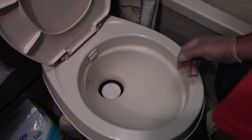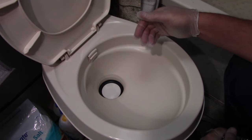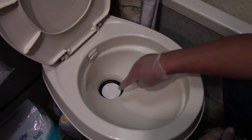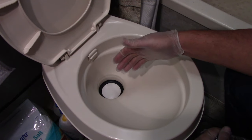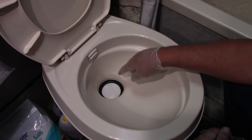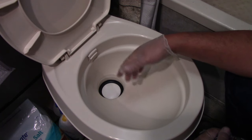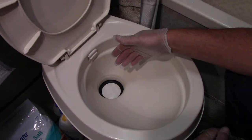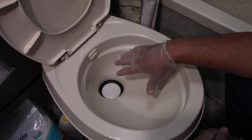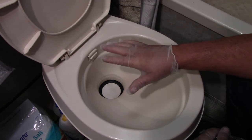Hello guys, here I am back with a video that's not such a pleasant thing but it's necessary if you own an RV, travel trailer, or camper — changing this ring. Sometimes after some age this ring wears out the seal and your toilet will not hold water. If it's losing water, that seal's bad. It's actually not a hard thing to replace; it is kind of nasty, but put on some latex gloves, shut off your water, drain it out. It's nicer if you empty the tank and clean it out so it's not so bad.